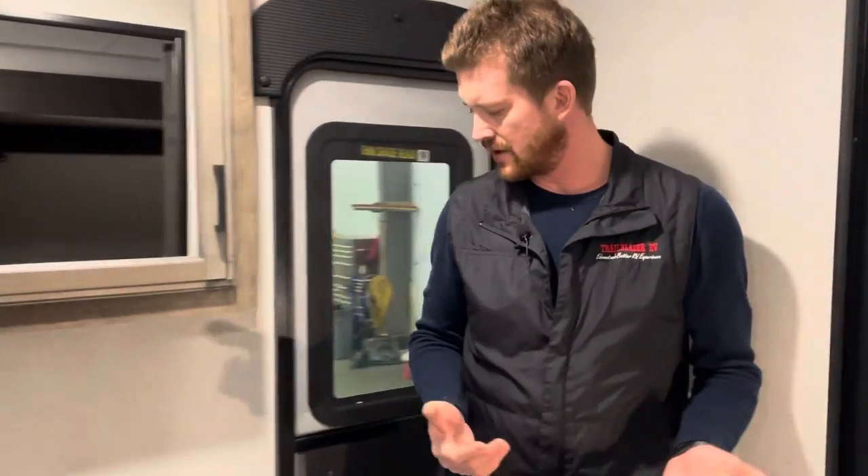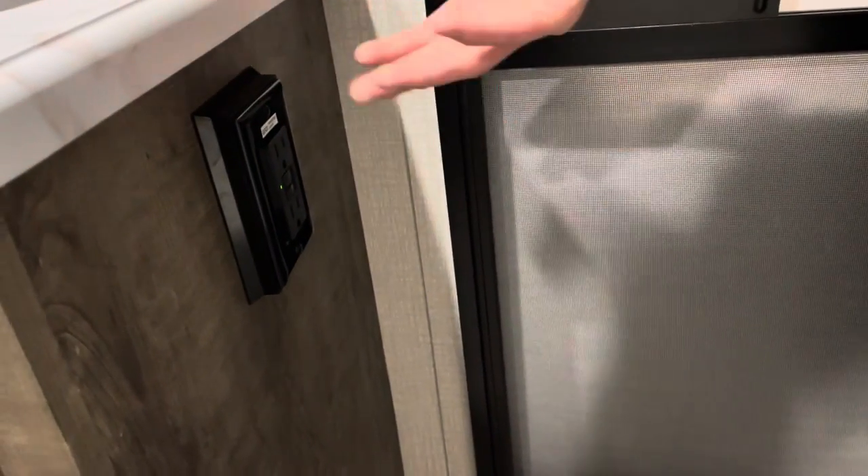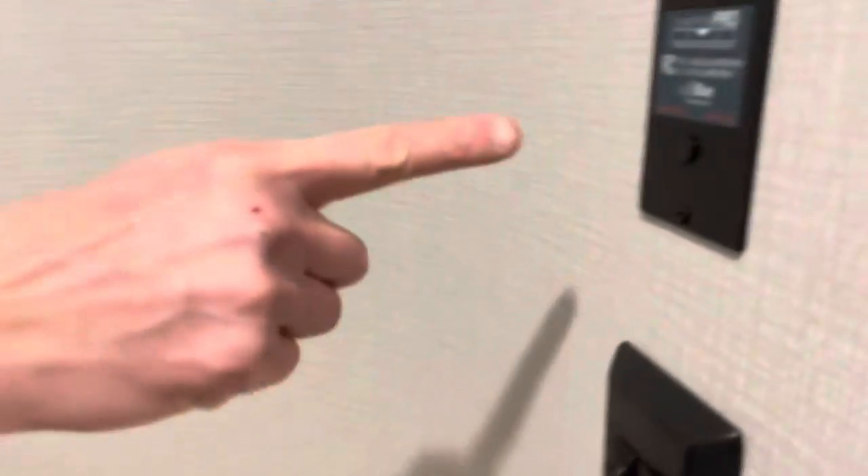Here in the bathroom, there's a notable power outlet — it's your GFI outlet with test and reset buttons, just like the GFI outlets in your home. One big difference in an RV: all of your 110-volt power outlets are wired in series with this, so if you trip the GFI you'll lose power at all of your outlets. If you're ever plugged into power and wondering why none of your outlets are working, come into the bathroom and press the reset button — everything should go back to normal. You've also got in here your LevelMate Pro panel, which you use with your smartphone to assist with leveling the RV. You'll need to set this up the first time you use it and sync it to your phone — search our 'Setting Up Your LevelMate Pro on Venture RVs' video for that.